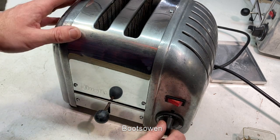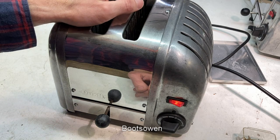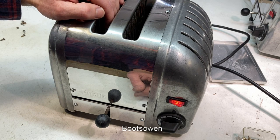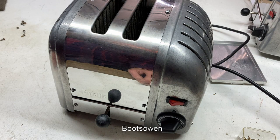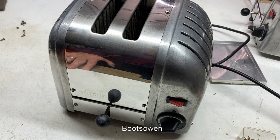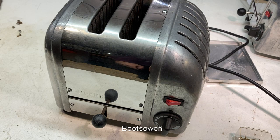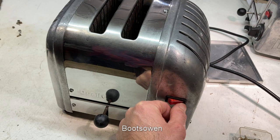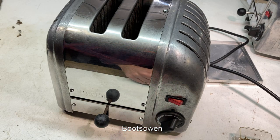Let's turn it onto one toast - it's a bit wobbly. I'm not getting any earth leakage into my hand. I can feel both sides of that heating up, and only one side of that one heating up. Oh, we lost the circuit there. Plug that out - something went wrong. It popped the miniature circuit breaker. Let's try starting it on two. There's power up to the neon but nothing else - something strange is going on here. I'm going to have to do a diagnosis.